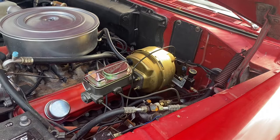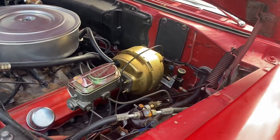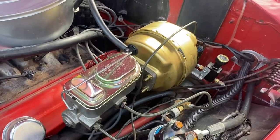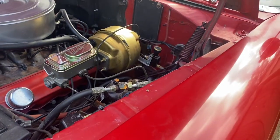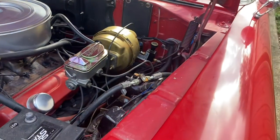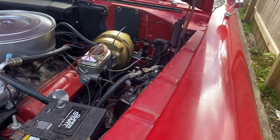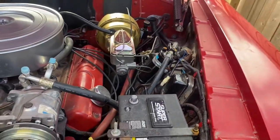Leave a comment in the comment section below and I'll do my best to answer any questions you guys might have. One more thing — this is about a 7-inch booster on here, and the pedal doesn't go to the floor or creep down to the floor. I got a good solid pedal. I can slam on the brakes — it doesn't lock them up, but it slows down seriously quick. It's a big heavy car.